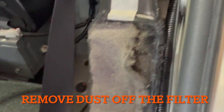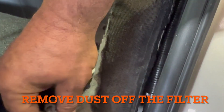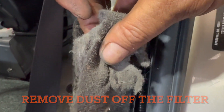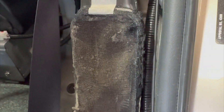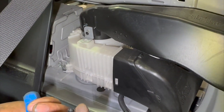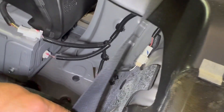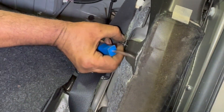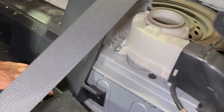If you can see this, this is the duct that supplies air to the fan, and the fan keeps the battery cool. If this gets blocked, it's going to reduce the life of the battery — that was the main issue. Toyota recommends that you clean this after every third to fourth service. This owner hadn't done the hybrid battery servicing, so that's why the battery blew up too early. This duct has three quick-release pin clips. That's the impeller fan — it was not getting enough air because the inlet was blocked, and it blew up the battery.